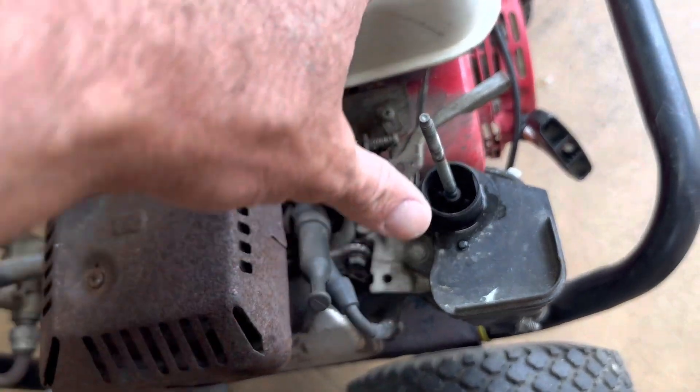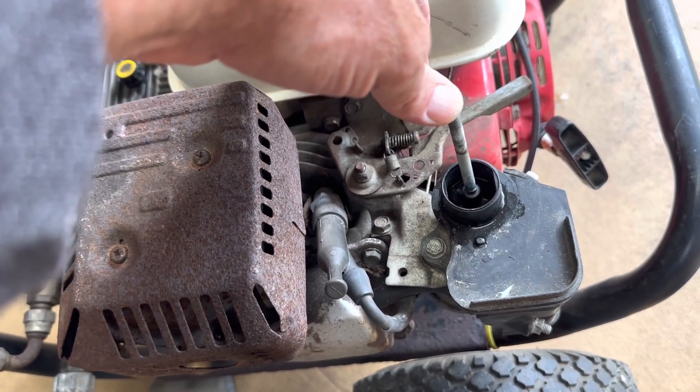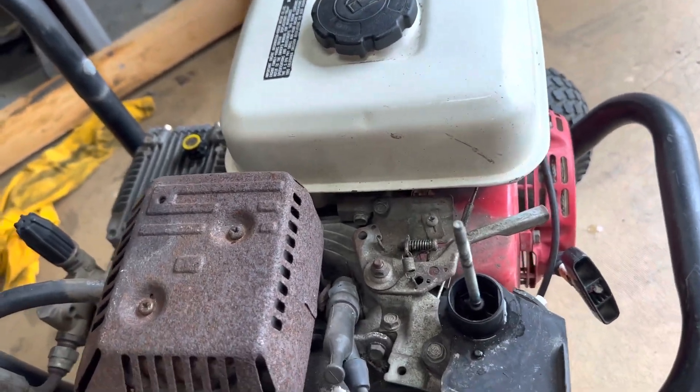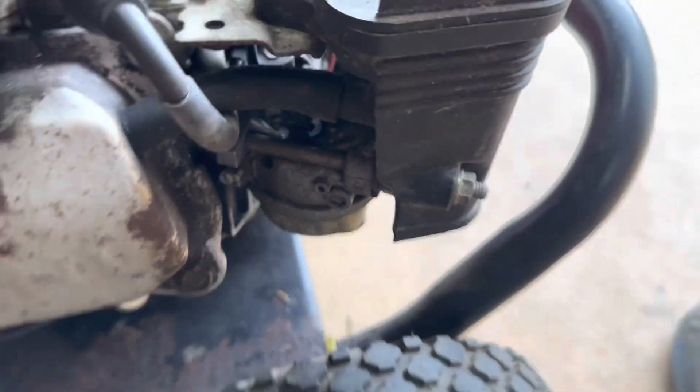So what I'm going to do, like I do on all of these — it's kind of repetition now — I'm going to take this carburetor off. I'll unhook the fuel line from the carburetor to get it off and go ahead and run all the gas into a bucket and dispose of it properly. A lot of times I run water through it, but we'll just see what it looks like. This little carburetor looks pretty easy to get off. Should be done in about 20 minutes. I'll have to hook water up to the pump to test it, so let's see.